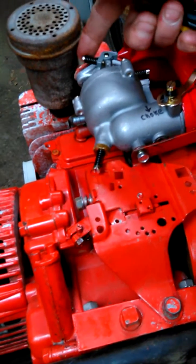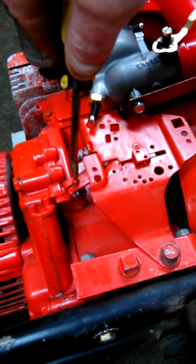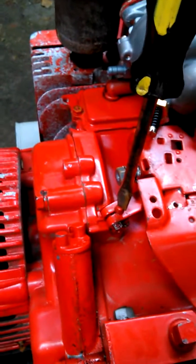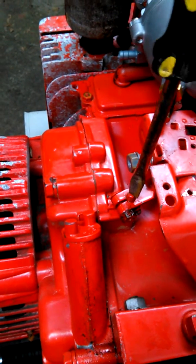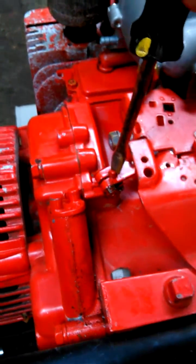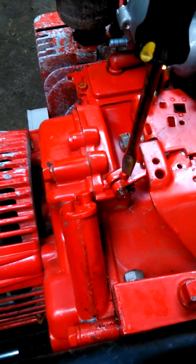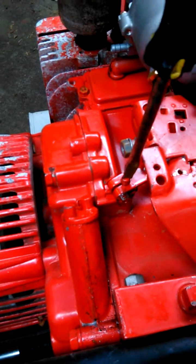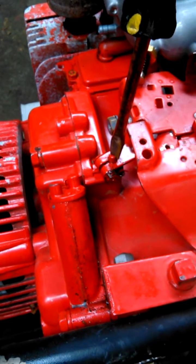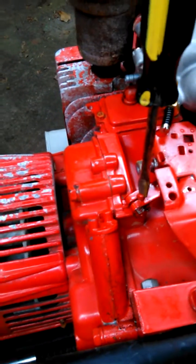One position is idle, the other is wide open. Turn the little slot rod clockwise and you'll hear a ting ting ting — that's the little governor arm hitting the governor gear inside the block. Turn it clockwise all the way as far as it'll go.